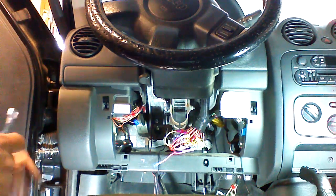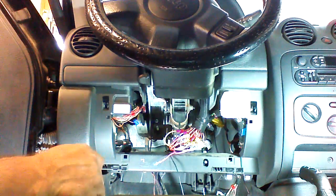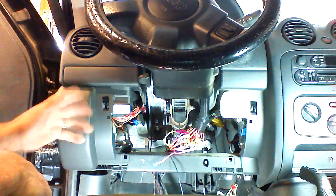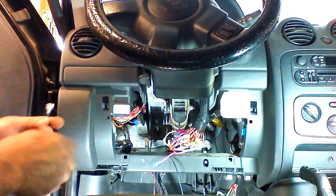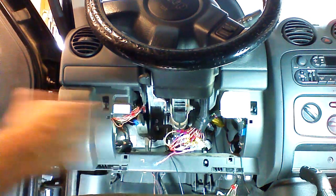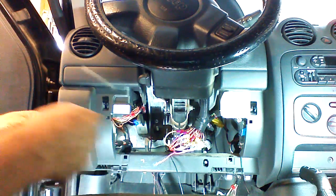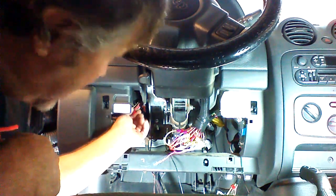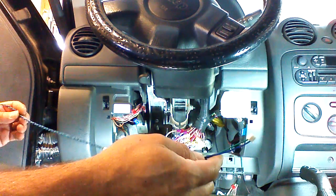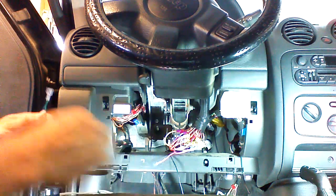Okay, we're back in our 2003 Jeep Liberty, and previously we used an ALCA to do our keyless entry and our hatch release. We couldn't get 3-press through data, so we had to install a relay. On these older ones, I may offer the kit without a module. It'll cut the cost down. If you bought a kit and you're going to do the locks without a module, we're still going to go to the same analog lock wire that we found when we were using the ALCA, but we're just going to use a lock harness with some resistors in the wire to control the keyless entry.